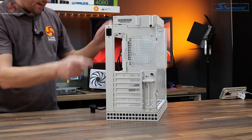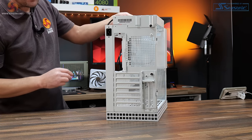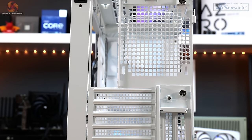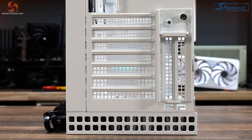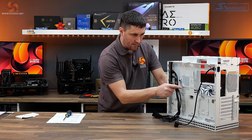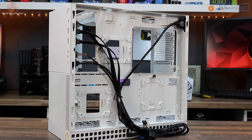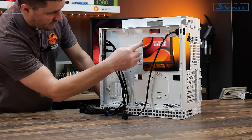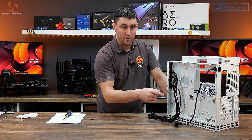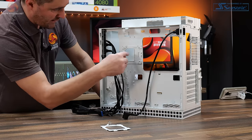At the back of the case you connect power to the mains, and there's an extension lead that plugs in at the side for a horizontally mounted PSU, or at the top for a vertically mounted ATX PSU. At the rear there's a cutout for the motherboard rear I/O, a vent for the 120mm rear fan, seven PCIe slots, and two vertical PCIe slots. Around the right-hand side there's quite a lot of space — approximately 30mm between the motherboard tray and the side panel — for cable management, with various cutouts for cables at the top, down the side, and along the bottom of the motherboard tray.